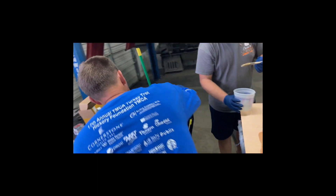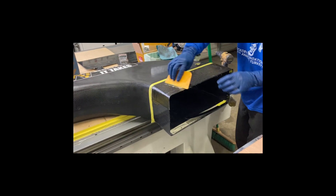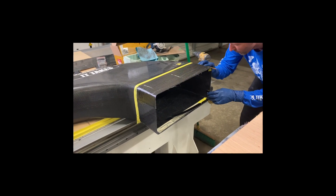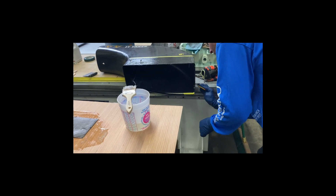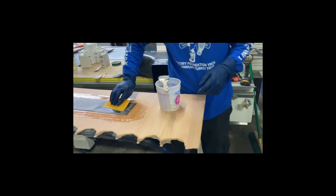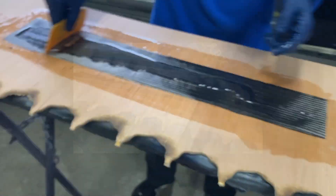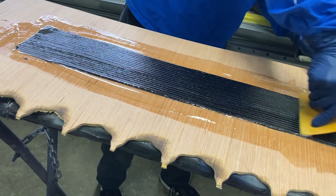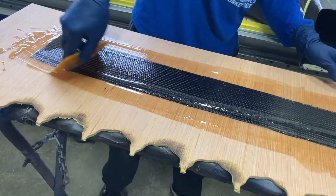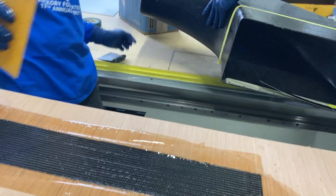Once it's on there, you want to press that resin all the way through the surface. I'm pressing it tight — the smoother you get it, the better off you're going to be. Now it's time to put it on the other side, so we're going to get the resin packed in on this other piece of carbon and flip the scoop over to apply it. We're going to do this twice — two layers. We're just trying to build strength because we don't want this thing damaged anymore, we don't want it to fly off. Going down the track, that doesn't really work out well. Keeping parts on your car is a good thing.